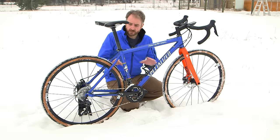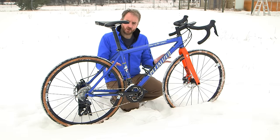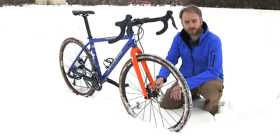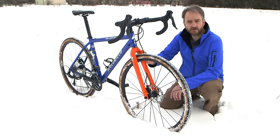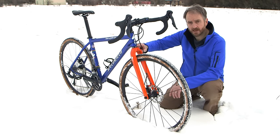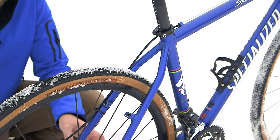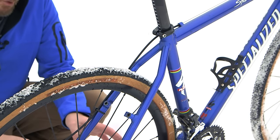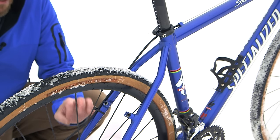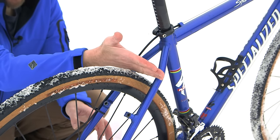The third consideration is fitting larger wheels. These old mountain bikes came with 26-inch wheels. On the front, since we're replacing the brakes anyway, you can install a 700C fork — the only consideration is that these head tubes won't support a tapered headset, so you'll need a fork with a straight steerer. Fitting the rear wheel is a little more difficult. I've found you can fit 700C wheels with a tire up to about 32 millimeters in width. Any wider than that and you'll have to cut out the seat-stay bridge.